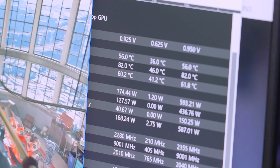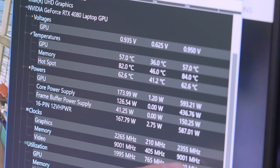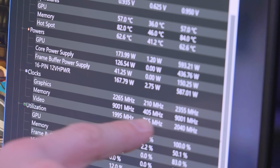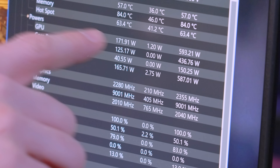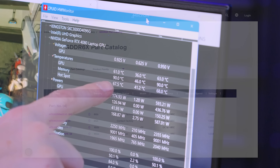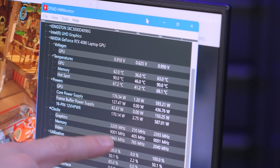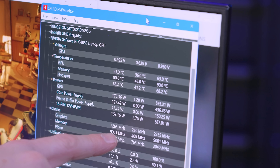What I want to see right now is our memory speeds — at 9,000 MHz effective. It's 82C. They're not throttling, but this is still not ideal. I really wish I knew what the before temps were now. I don't know what the max operational memory temp is, but I have to assume at some point if this continues to climb, we're going to drop down from 9,000 MHz.